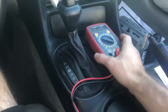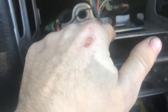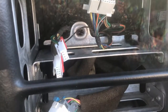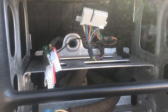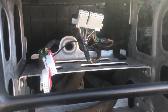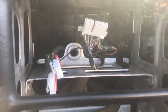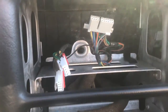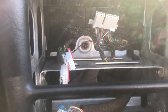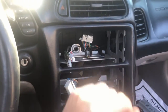I've used my multimeter checking for voltage — you could do it for continuity, but I just did voltage with one on the ground and one on the positive. This is the radio harness. Basically, orange is the battery feed and black and white is the ground. After some research and poking around, there isn't really an accessory wire — it must get accessory power from somewhere else, so I'll have to look into that more.